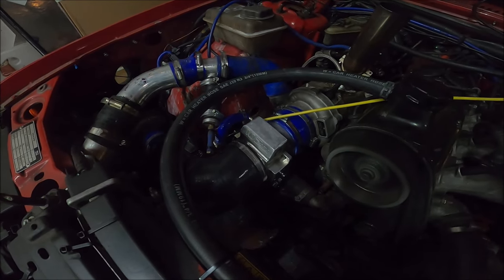Well, first signs all seem normal, so I'm going to take off this one, because obviously that would be the worst one, if any, because that's straight after the compressor. And if this has got none or next to none, then my theory that the second throttle means the usual scare stories about needing a special carbon seal behind the compressor wheel is bullshit. But I don't know, so we will see.